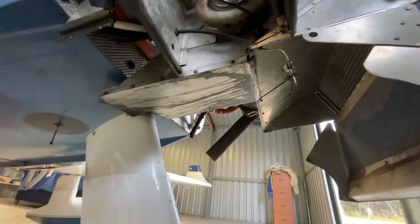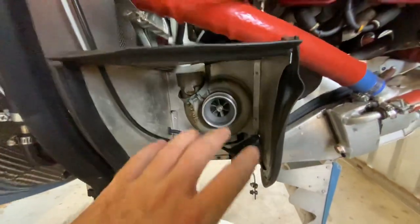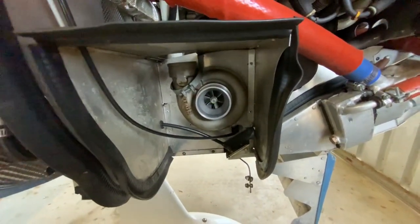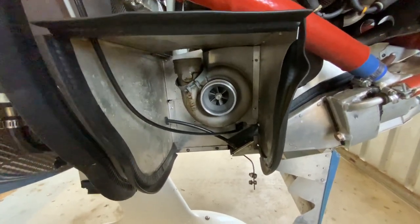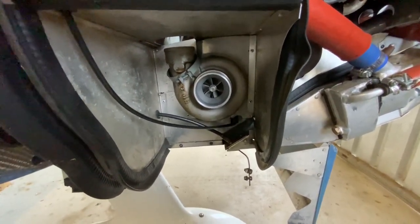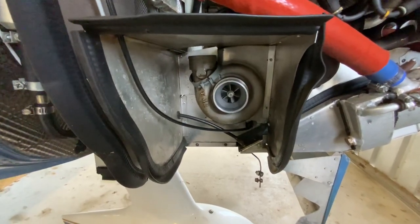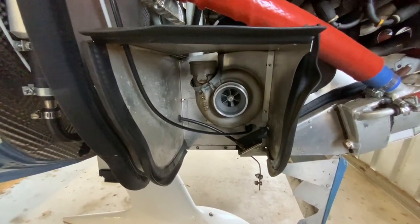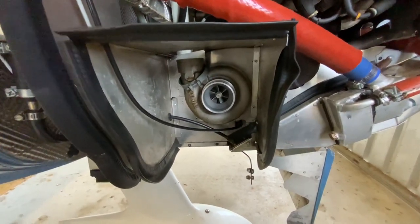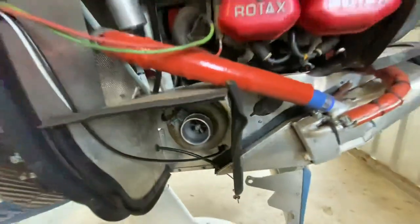That big metal box is where the hot side of the turbo is meant to be. The cold side doesn't really need anything — it just needs air through a filter. The hot side, however, is actually pretty important: it needs cooling air so the oil inside has time to cool down. If the oil gets super-heated it does something called coking, where it burns itself onto a shaft or metal surface. Once it burns on and goes hard, the next time you start the engine that coke is still sitting on the turbine shaft. It wears a little bit away each time until eventually it's worn enough that the whole turbine wheel can flap around.